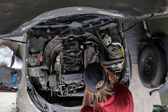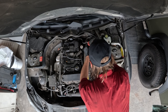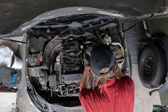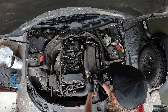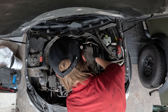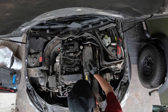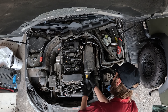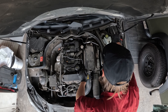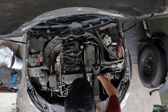There are a couple of other things I would have included in this job. The throttle body — you're going to have to take that off and there are two gaskets on it, so you could easily replace both of those. I was planning on looking at the intake manifold gasket and judging by how that looked. I'd also just plan on doing that air filter as well if you haven't done that in a while.